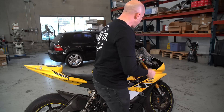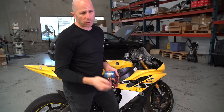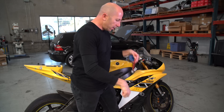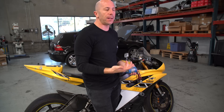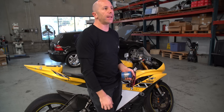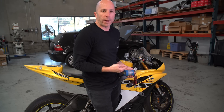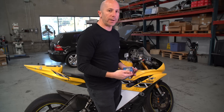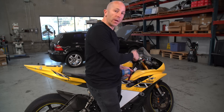Now we're at my buddy's race shop and he's got this race Yamaha R6 with aftermarket grips. Same thing as a dirt bike or road bike — you're always pulling on the grips for throttle, or hitting whoops on a dirt bike, and you never want the grip to slip. Back in the day you might use hairspray, but safety wire is really the best way to do it. If you look at any race bike in supercross, motocross, or pro road racing, the grips are always safety wired. There's a preferred technique where you wrap it twice — let's do that right now.